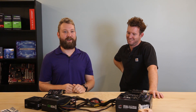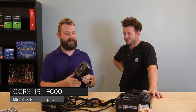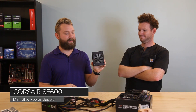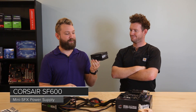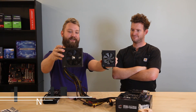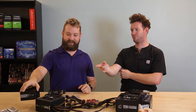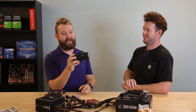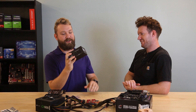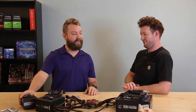We're choosing all the smallest parts we can find. For the power supply we got a mini SFX power supply, which is pretty cool and small. I brought out a normal-size ATX power supply so you can see the difference — about half of that we can strip away. It looks like we can take the fan out and it'll be significantly shorter without it.